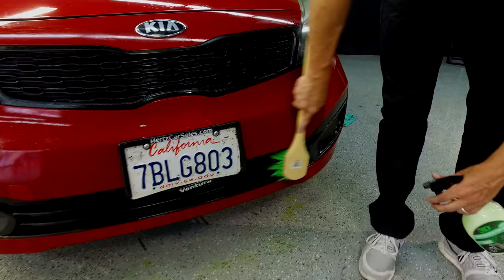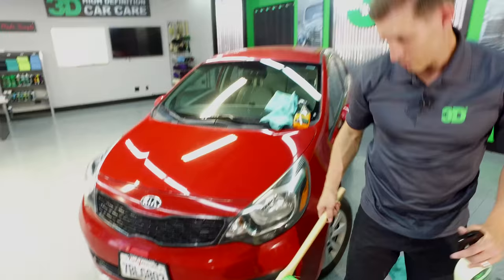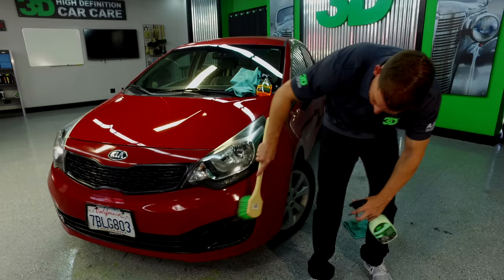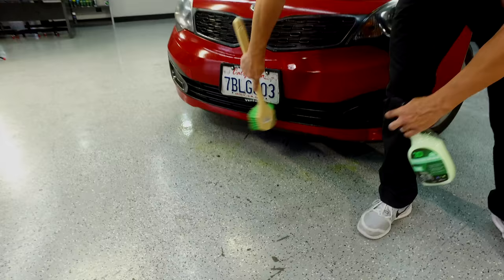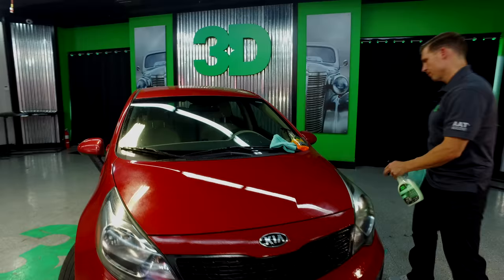You will get light scratches, but anytime you're trying to get rid of certain things on a car that was as bad as this, you're going to get a little bit of a scratch — it's going to be very difficult. A pressure washer most likely will not remove all of this; it will take a little bit of elbow grease and some enzymes to eat it up. Put it here on the license plate as much as you can. Now we've loosened it up — go ahead one more time, rinse it down with your waterless car wash.